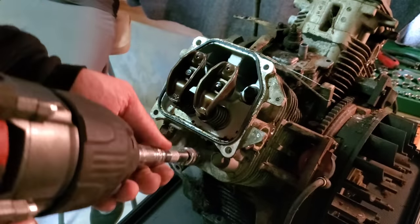All right, it's day two. We've got the alignment pins pulled out. We're going to block this and get all of this grunge off of here. We've got to make sure to pull this because the inner filter is collapsing and disintegrating. So we're going to get that out of here while we're here right now. This is the only time that that filter is doable. So make sure, if you order a kit, that it has this and it has a piece of filter media in it.